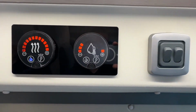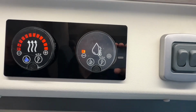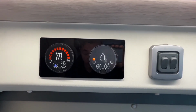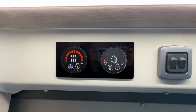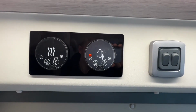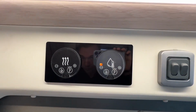To operate the hot water system, so again you've got frost start, which is 5 degrees, keeps the water in the boiler above 5 degrees, but again you do have to have gas or electric available to the vehicle. Should you not have that in the winter, we strongly advise that you winterize and get rid of all the water on board.